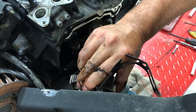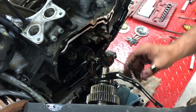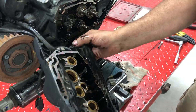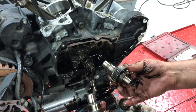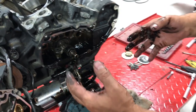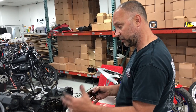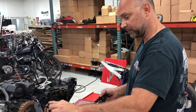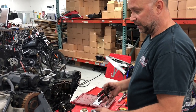Our number one and number two cams stuck with it — just slide them right out. Number one slides right out, number two slides right out. Number three and number four slide right out of there as well — very simple, they slide right in and out of the bushings. On a Sportster and the earlier model Buells it goes one, two, three, four from left to right. On the Buell XB it goes one, two, three, four from right to left.